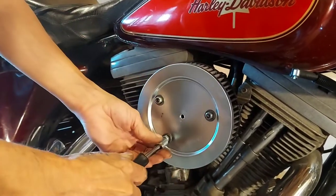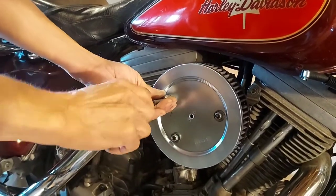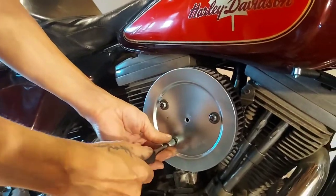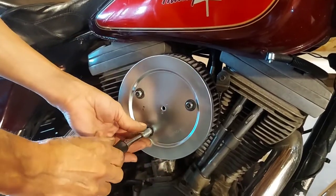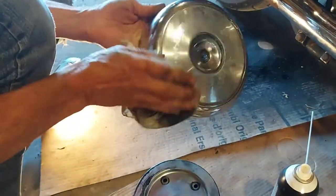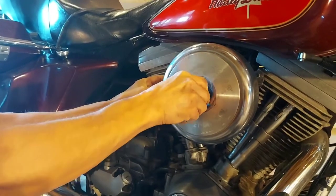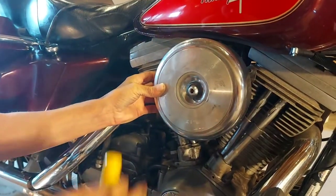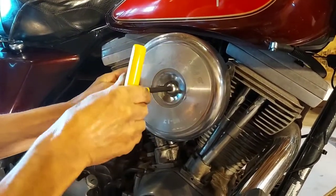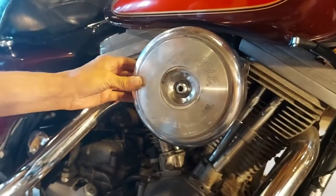You don't really want to hammer them on there — just until they're tight, just by hand. Use a driver; a little more than finger tight will do. Go around and cinch them up again. Don't overtighten them, just check them so they won't back off. Just clean that out while we have it off the bike. Make sure it's centered and straight — just a little more than finger tight, so it won't rattle or move around.